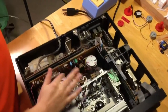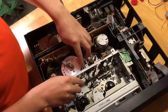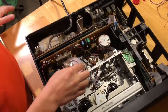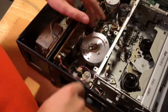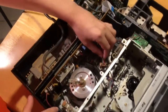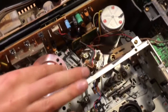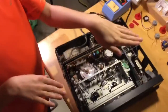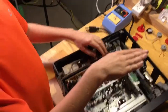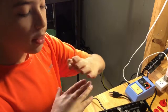The reason there have to be two video heads is because one can only do the bottom half of the frame and the other does the top half. This drum is spinning around fast while the tape passes in front of it — the tape is also moving but not as fast. The heads send data down to the board below. This little component over on the other side is your audio head — this reads the audio off the tape.